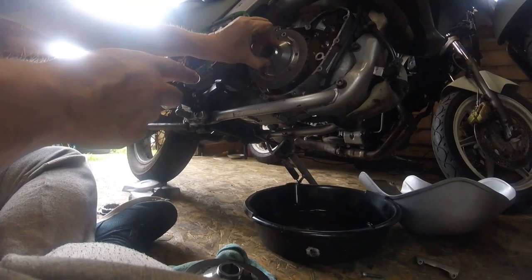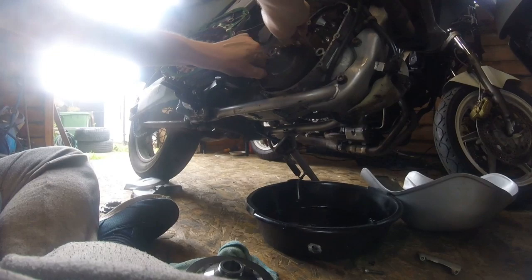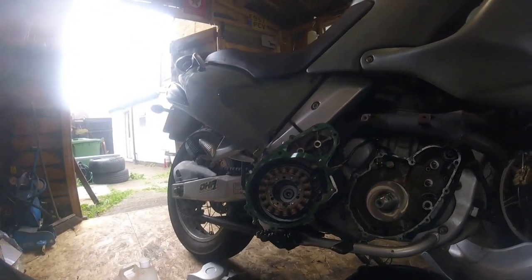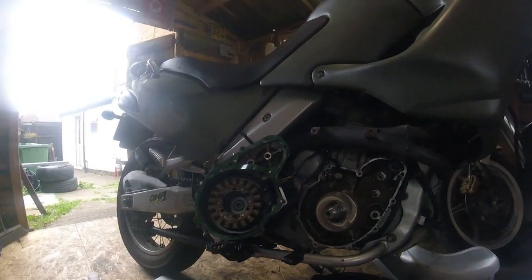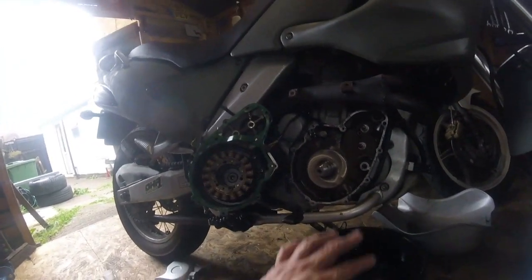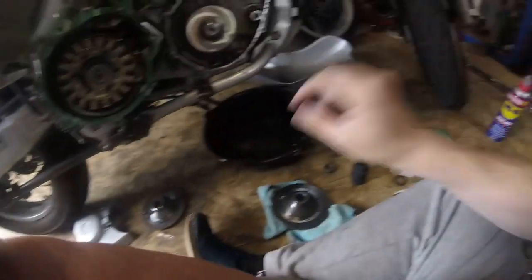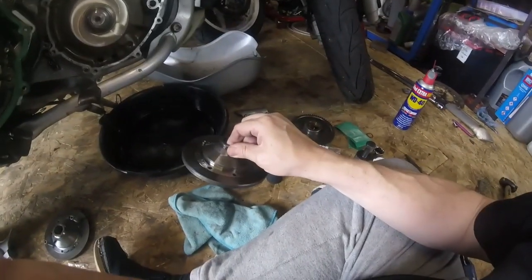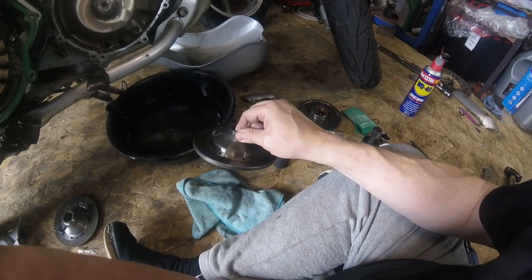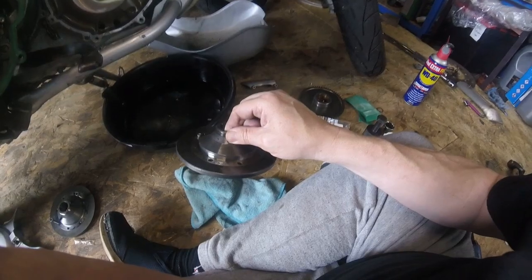Aprilia. Next to no movement. So when that's torqued up, it's going to be nice and tight on the shaft. Now I have lapped that one in to this, and I will now re-clean it. It just shows you, this came with the sprag clutch, and I can remember saying at the time it was 1/10 of the price, and all the machining marks and stuff on this, it looks exactly like the Aprilia part, which is why I was happy to use it.